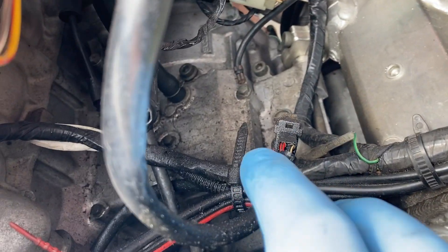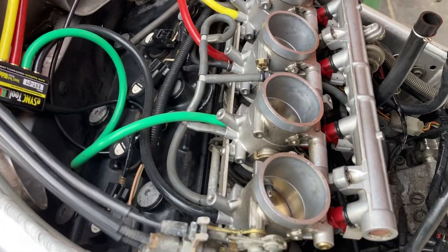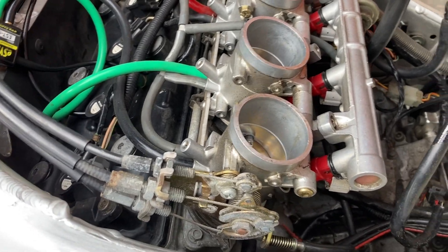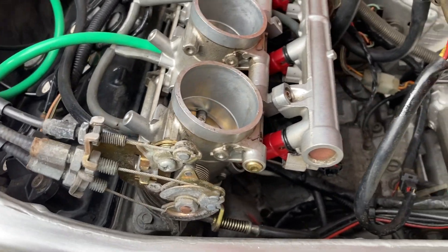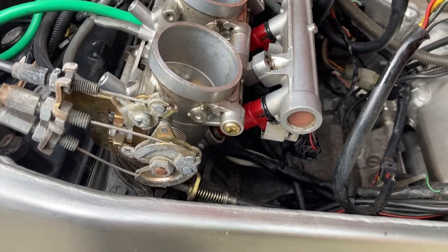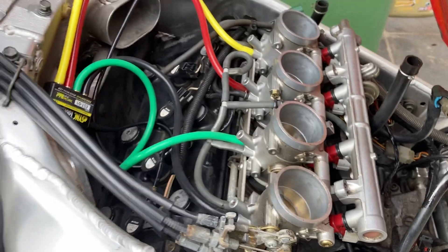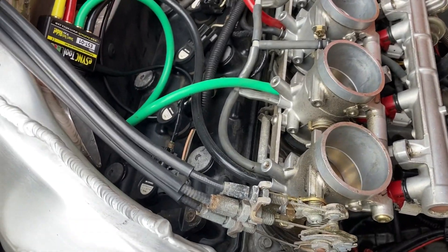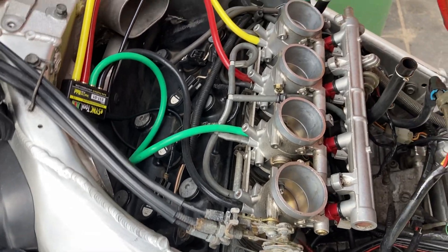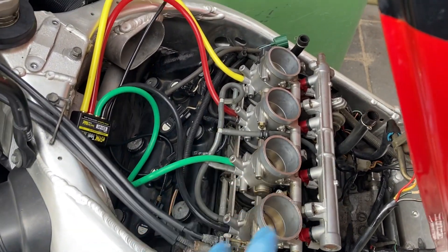So here it's definitely going to need a good clean as well. There's a lot of oil that came out, and because the engine is on quite high mileage and it's a sport bike, people have probably ridden it really hard for a long period. Now I'm going to use a little bit thicker oil — hopefully that's going to stop the smoke, but if not that could mean unfortunately an engine rebuild. Hopefully that's still far away. Now just clean up everything, open up the sides and replace the oil.